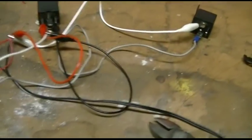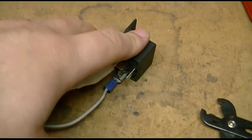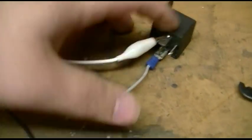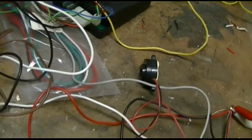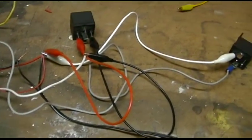Here's what we got so far. This is the trunk output, which we'll just use as a test first to make sure we can actuate that with the remote and program the remote, because we'll hear the click of the relay. This is the parking light relay — I remember this would go click-click-click and then actually pulse the door locks, which I haven't gotten to yet. So I just got to find the remote, which should be in my trunk, and we'll get going.